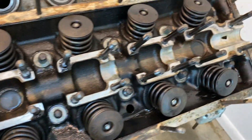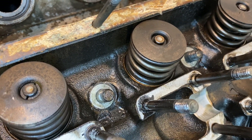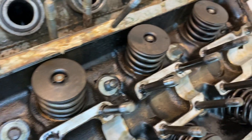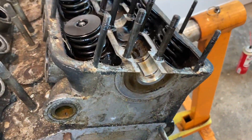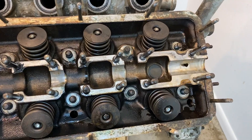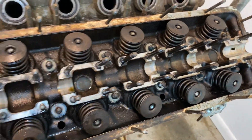These Ferrari heads are notorious for getting stuck. What ends up happening is the studs — where you can see I took the nuts off — water tends to get down in there, or weep between the head gasket and the stud, and it creates electrolysis that locks the head in place because it's a steel stud on an aluminum block. The heads are pretty well stuck, so you need to put a fixture plate on it and slowly start taking it apart. I'm going to spray it down tonight, put some penetrating oil in there, and hopefully break loose some of that electrolysis.